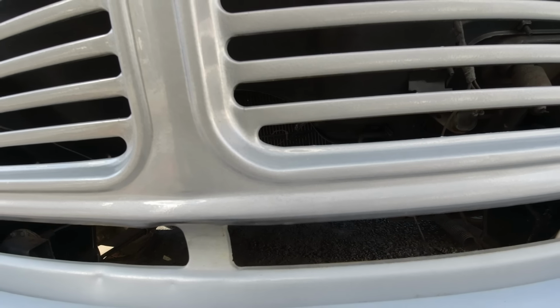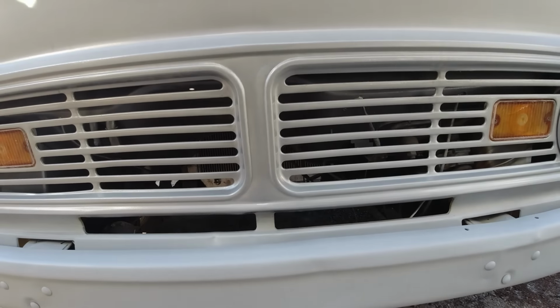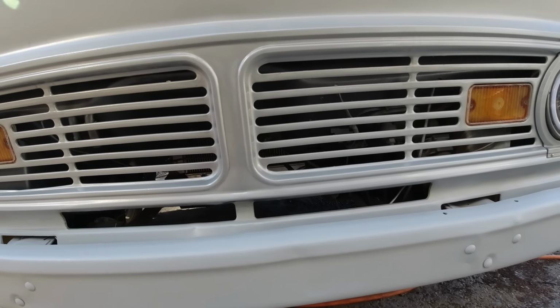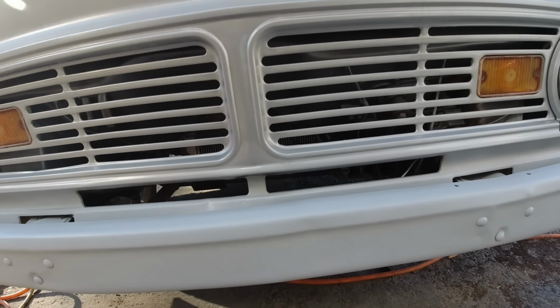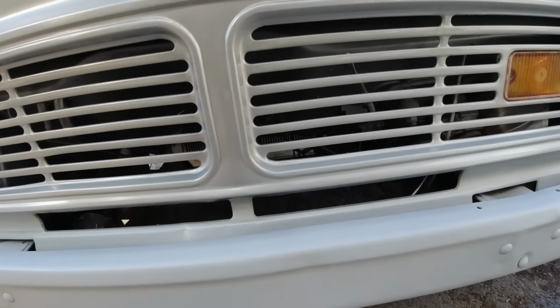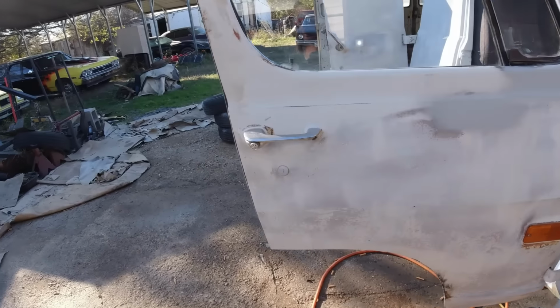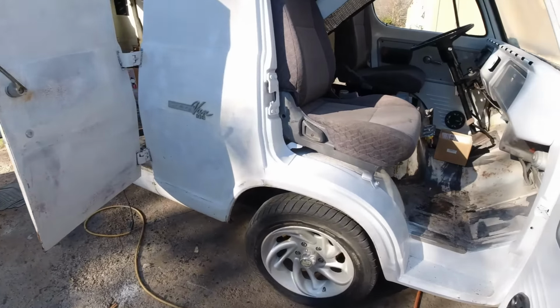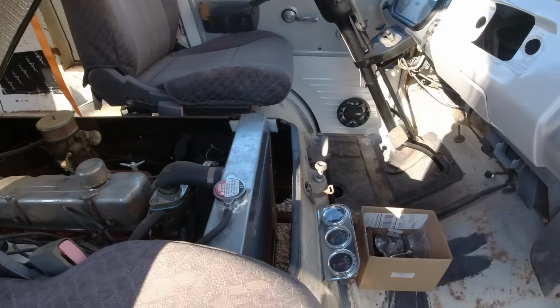Because, you know, I've heard there's lots of problems with these fans overheating, but I figured it'd probably be with the V8. Didn't think a 6 would run hot. But anyway, driving will be okay. But if you're stuck in traffic or something and idling for a long time, or maybe going up a mountain, flick on a switch and turn that electric fan on and cool it right down.